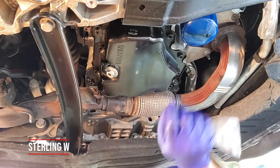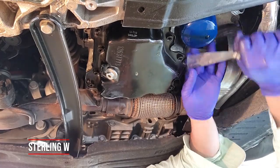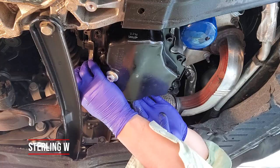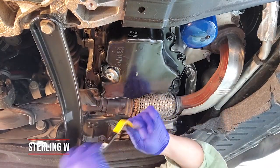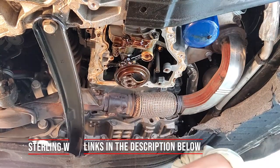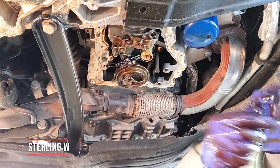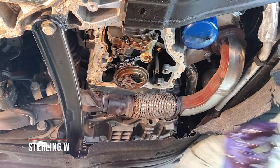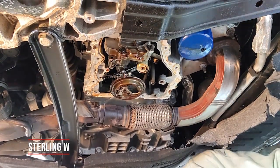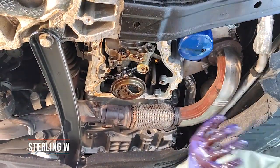Work each side slowly, prying it out using the two notches. The notch actually helps open it up, and then I use a palette knife to start cutting around the edges to weaken the gasket material. By cutting I mean slotting through to weaken it so I can pull the pan straight down with the pry bar — I'm not really prying, just pulling down using the angle of the bar. It's nice and thin.